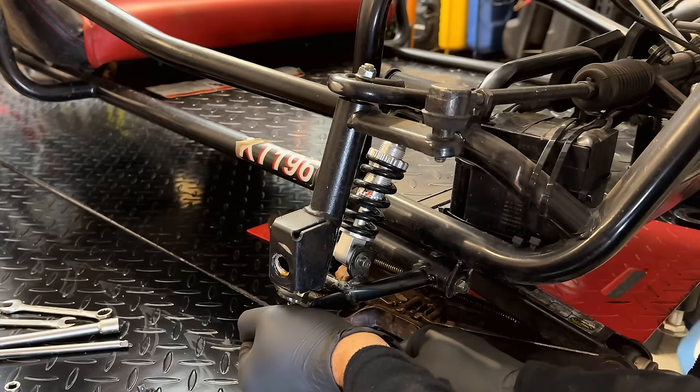Yeah, I just double-checked online the specs for a Honda GX200, and the standard size is 1.18 inches on this journal, and that's what I measured with the caliper. Now, the same article said we are allowed up to 2/1000 of wear. And in this case, we are coming in at about 1/1000 of wear. So we are within spec and we can use this crankshaft.